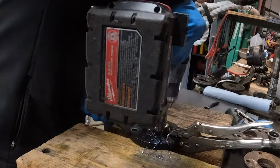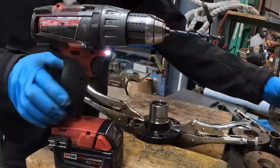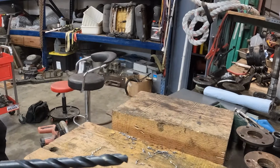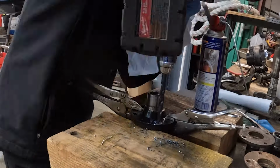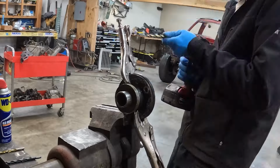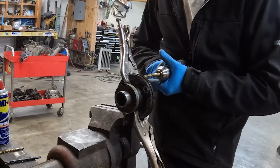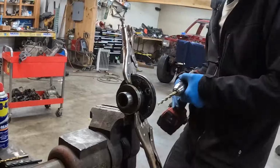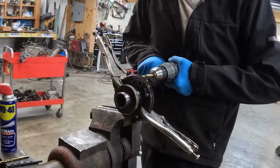It's kind of a hassle. It's annoying when engineers have to continue to change the stupid bolt pattern, dude. Just leave it alone. What I ended up doing here is adapting that third gen 4Runner double cardan joint. That particular flange on the drive line matches the pinion flange from the 05 plus e-locker stuff that I had. So there's really no rhyme or reason why you're changing these diff flanges and things like that. But anyway, that's the long story about what went on here.